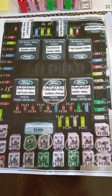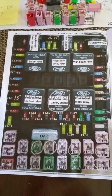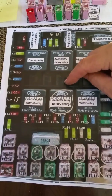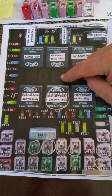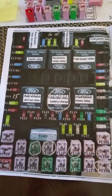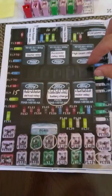I discovered that the fuel pump relay — this is a picture of the circuit board, the fuse panel — the fuel pump relay is soldered onto the board. Ford's only fix is to replace this whole unit. Well, I found this relay, found the part — F8VFB-A — for $9, and all you do is take this out of the vehicle.